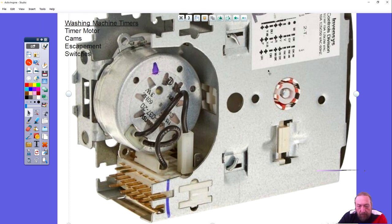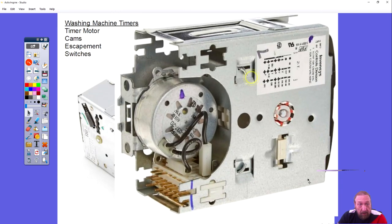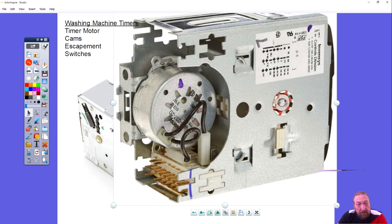Going back to the timer — these are the wire colors, and you read them left to right. The three pins on the left correspond to the far pins on the left of the timer; the ones on the right are closest to us. This is the timer shaft, but this is the back side. When you push or pull the timer knob, watch this piece slide up and down — that sliding activates the very first switch, which is the master on/off switch on the timer.